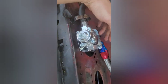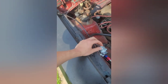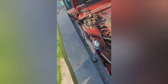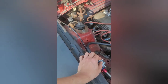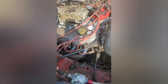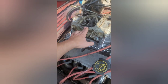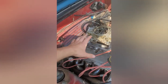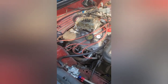So if you tee off before the regulator, this allows you to run as much pressure as you want, but also get it down to zero pounds of fuel pressure. The basics for this: you want about six and a half pounds of fuel pressure — that's normal for a carbureted setup. Then you just get some 3/8" fuel line and run it into a fuel log and into a Holley carburetor. I like Holleys — I won't use anything else. Maybe a Brawler or a ProForm, but they're all based off of a Holley. Find yourself a nice used Holley 650 if it's a stock motor.